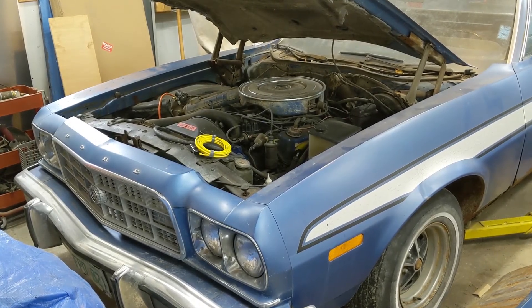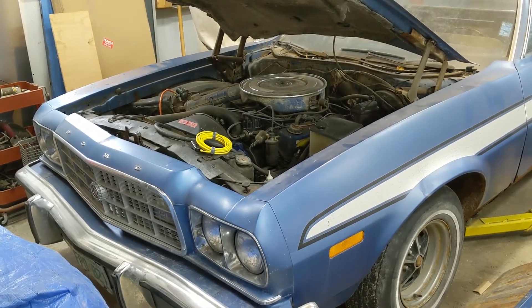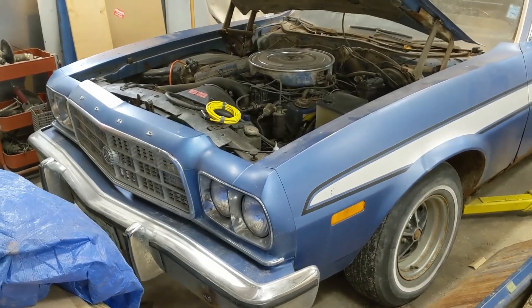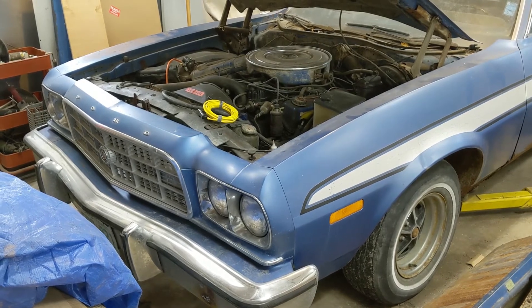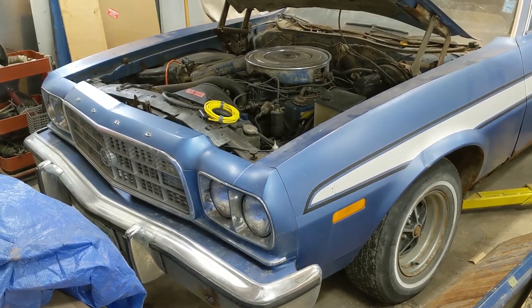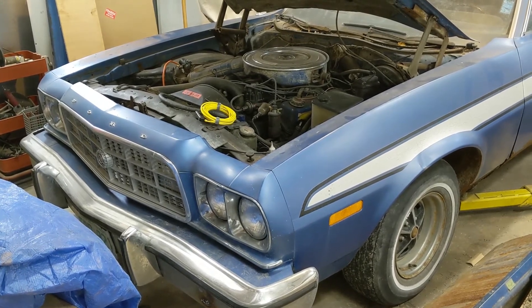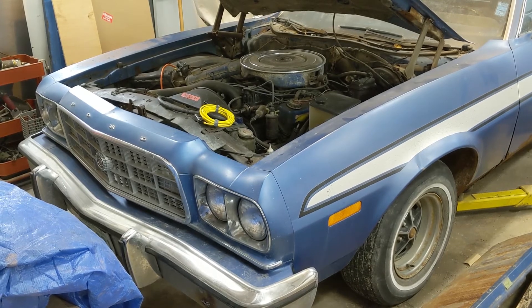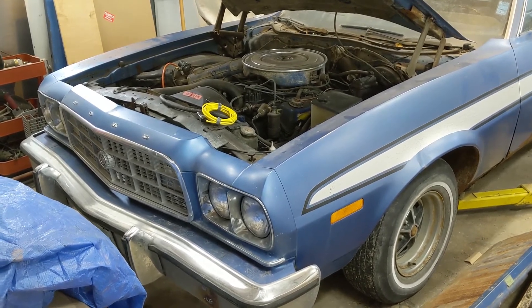Got the camera all coiled back up again. Turns out to be an open chamber head — just as suspected, or heads rather, on this engine. The engine was made in March or February '73, so it's highly unlikely it would have been a closed chamber. But I had a good time checking and you never know when a unicorn will come trotting your way — and now I know. There's no shocker, and if someone buys this car I can confirm to them that it's open chamber heads.